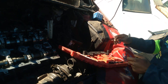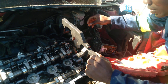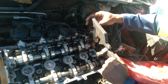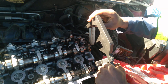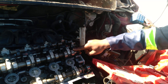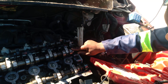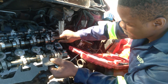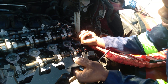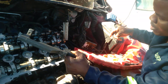After that we have to take the camshaft locking tool, which must be inserted like this. Make sure this timing segment is on a flat spot — the top part must be flat and the bottom part of it is a curved surface.